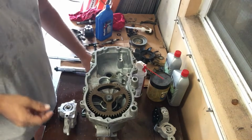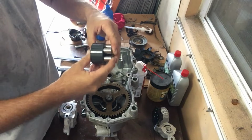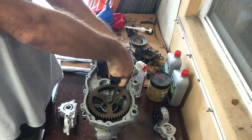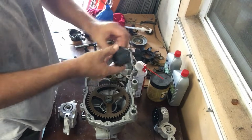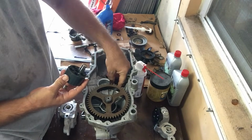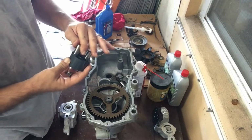So here's what I found worked the first time I did this. Again, you're probably going to have to do this a bunch of times to get it right. Taking the pump, turning it over, putting it on top of the bearing thrusts while holding the pistons in, but they will fall out. That one just did. So then you have to do it all over again, which is fun and exciting. Again, this alone, I probably had to do 8, 9, 10 times the first time I did this.